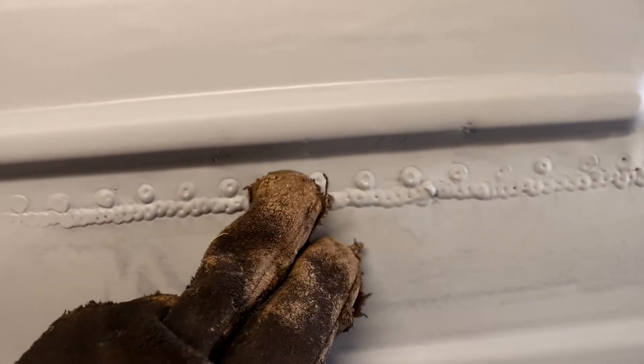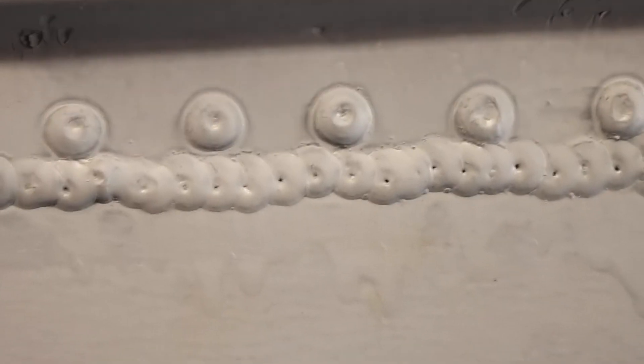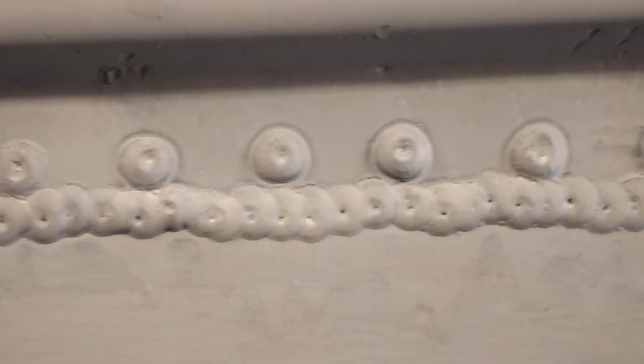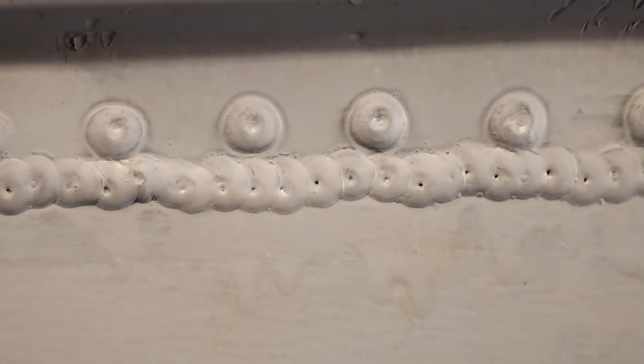The type of welding I've done: I've plug-welded in those holes to hold it in place, and then I've gone along to fill the step. As you can see that disappears quite nicely. I've still got a bit more finishing up here.